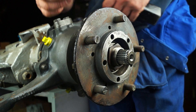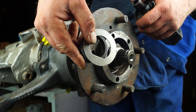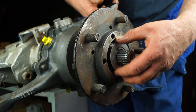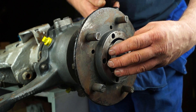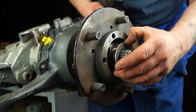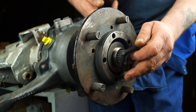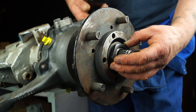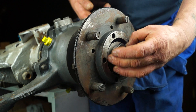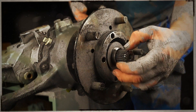The other great difference with a bearing that needs to have the end float set is it will have a lock tab and a lock washer. Once this washer is on I have to find where the tab slots in, which in this case is at the bottom. You need the locking washer even when the lock nut is tightened up — this will stop the lateral force of the bearing winding the two nuts off together.